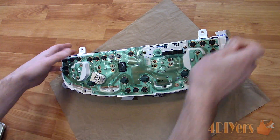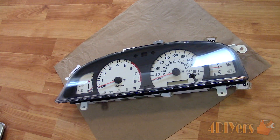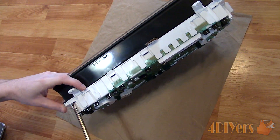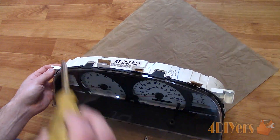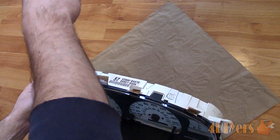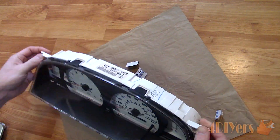So to keep the assembly apart, I used little pieces of folded over cardboard to hold it open — intended to be stuck between the white and black plastic assemblies. Work your way around evenly, don't force it apart as you can break the clips. You can also use a standard screwdriver to lightly pry it open as it can stick together. Gently pry so you don't damage any plastic components. Finally, the lens assembly can be removed.